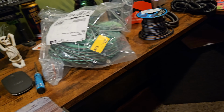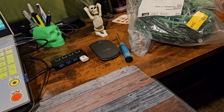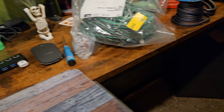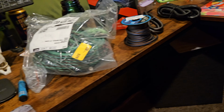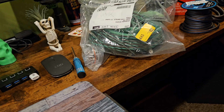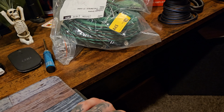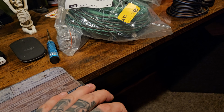It'll have a single 10 Sundown Audio and a custom ported enclosure that's tuned all the way down to 35 hertz. For you nerds, that means it gets really low. Nice, awesome bass. And that will be running on a Memphis Class D. That is 1 ohm stable digital. I think it's 1100 watt 1 ohm stable amplifier. So that thing I've had for quite some time also. And it bangs. You can hear that really good.